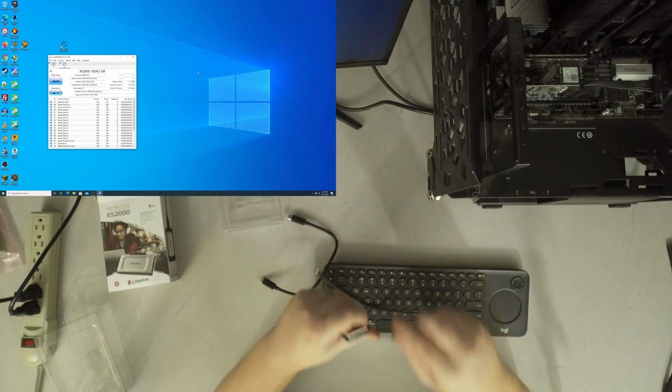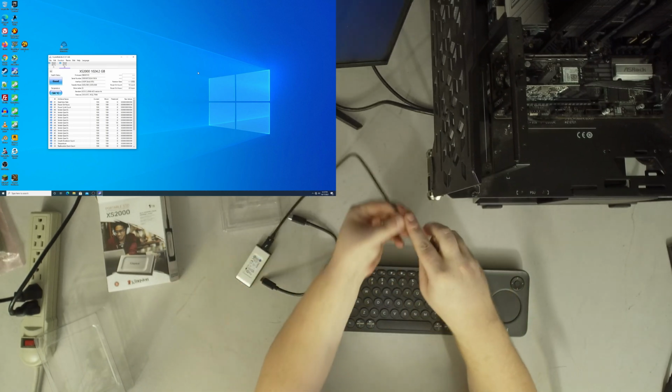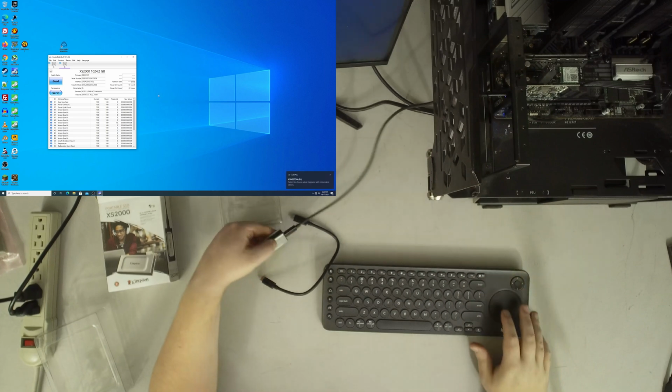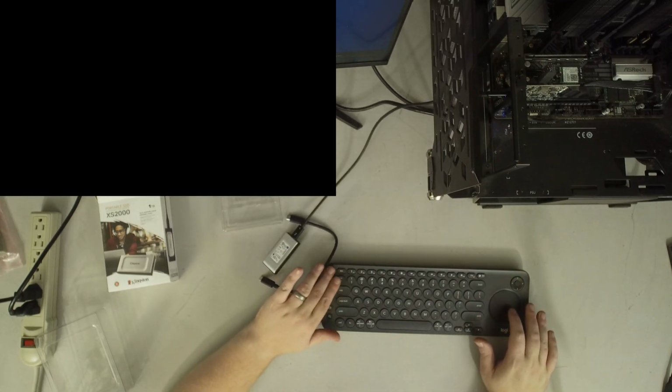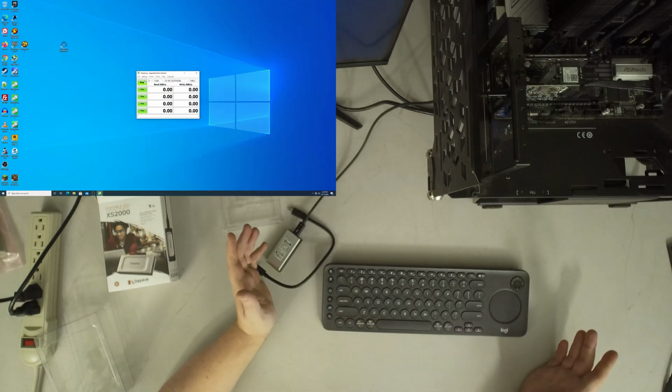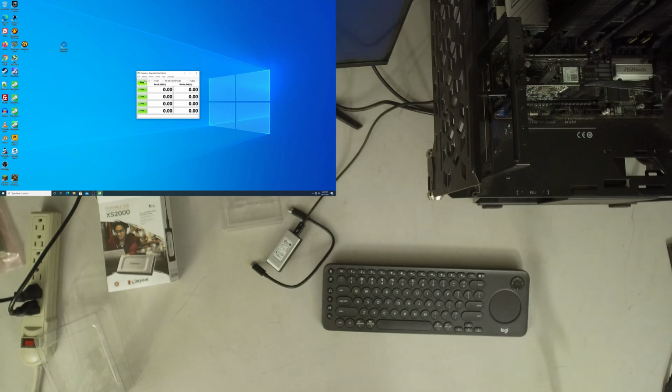Now what I want to see is how fussy the cabling is. So this is a Thunderbolt 3 cable. This came in an OWC Thunderbolt 3 SSD that we reviewed. And we're going to open up Crystal Disk Mark again and see if the Thunderbolt cable runs at 10 or 20 gigs a second. I don't know. And the reason I don't know is because the Thunderbolt 3 controllers, at least, don't talk USB-C 20 gig. But apparently the Thunderbolt 3 cable does. In fact, 2072, 74, I think that's slightly faster than the included cable, but that's still within variance between benchmark runs.